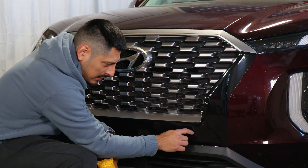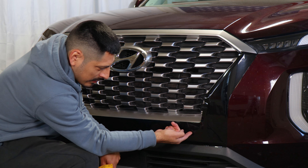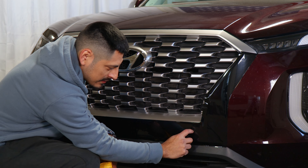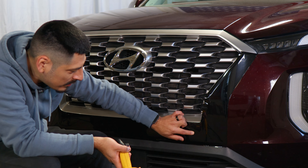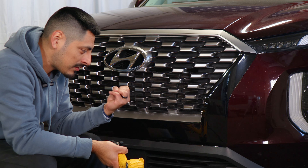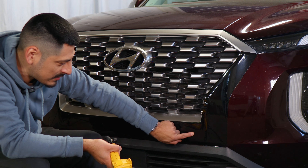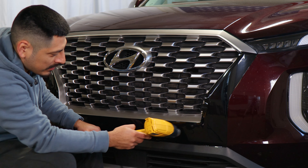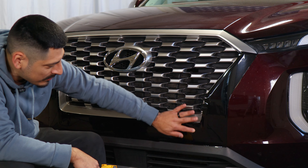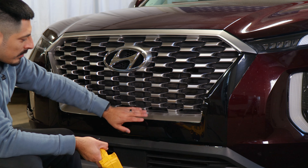For the sensor, it is optional if you want to leave the film right on top of it, but at least trim off around the area of the sensor. Depending on the sensitivity of the sensor, you may need to remove the film — if the sensor system on your vehicle activates, it's because the sensor is being blocked, so you'll need to trim off the excess material in that area. If it doesn't trigger, you can leave it. Just make sure you apply heat around the sensor so the film starts molding to the design of the sensor. Then once you're done, move on to the next piece.